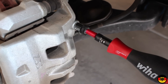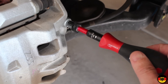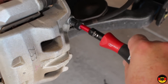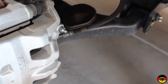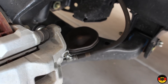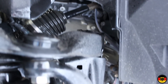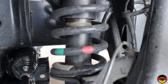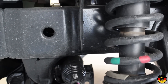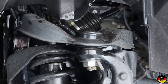I've bled both front wheels, checking the reservoir fairly frequently. On the bleeder screw, you want to tighten it up to seven Newton meters using a hand torque wrench, then put the rubber cap back on, and spray in here with some Armor All. I've soaked everything thoroughly with Armor All — things like the rack and pinion boots, bushings, all of the McPherson strut pieces, all the boots, everything rubber I can find. I'm also going to rotate the tires while working on this truck. The wheel lug nut tightening torque on this truck is 98 foot-pounds, so use a torque wrench and torque them in a criss-cross pattern.